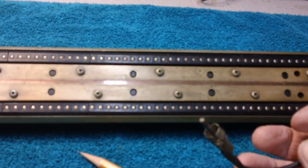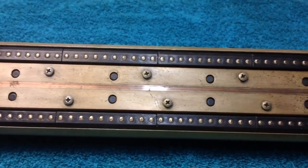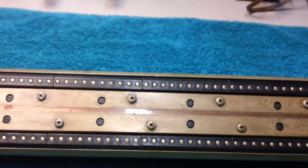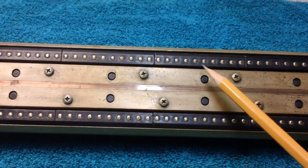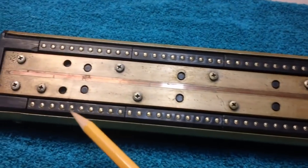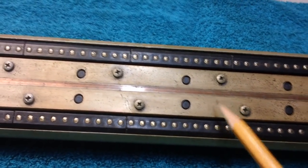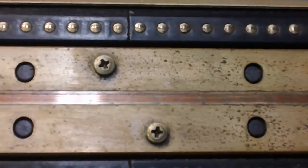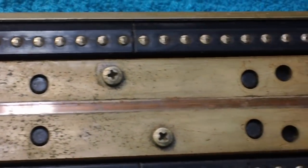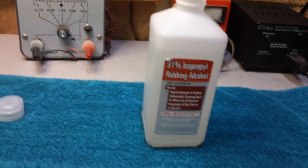This is another very important item — if you screw this up, you don't have a jukebox. What I'm going to do is clean these all off with alcohol and a brush, then clean this area down here. The nubs all look to be in really good shape — I don't see any problem with them at all. Once we get them clean, we're going to put some dielectric grease on them and make sure that thing is as functional as I can get it.